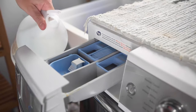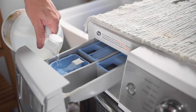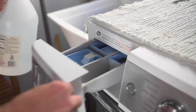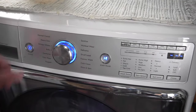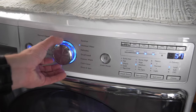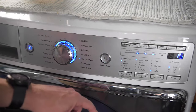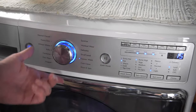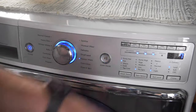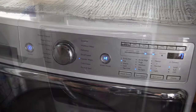Simply fill up the liquid detergent tray with the white vinegar. We want some kind of express or quick wash — this machine has an express wash setting, so we'll select that. It's 15 minutes, but we don't need it to spin because we're going to do a regular wash afterwards, so we can put it onto no spin, which takes it down to seven minutes. Quick and easy, away we go.